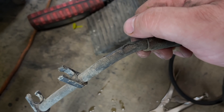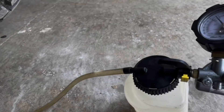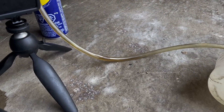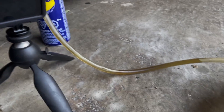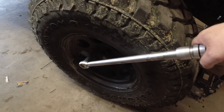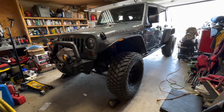Same with that brake line there — it's damaged. All the brake lines and ABS lines are tied up. I've got the brake fluid over there so we can start filling up the master cylinder and bleeding the brakes. I haven't even started putting a vacuum on it and I can already see brake fluid coming down. Now I've got five inches of vacuum pulled — you can see the brake fluid coming down. It doesn't even look all that bad actually. Always make sure to torque your lug nuts when you're done and check them after 100 kilometers. Jeep's all back together — tires are torqued, brake fluid's topped up, everything is bled. Shut her down.